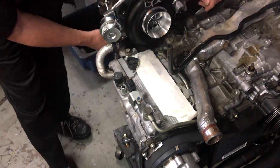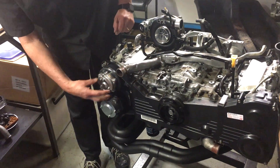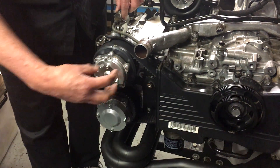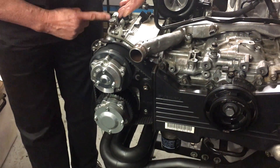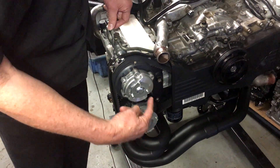This is why we've got it apart. I just want to show you here — the front of the engine has been assembled with the cam belt, tensioners and idlers. This is the variable cam control for the inlet and the variable cam control for the exhaust. Inside here is like a clockwork mechanism with a vane inside it — almost like a pump in reverse — and this solenoid is controlled via the ECU, which advances and retards the inlet.